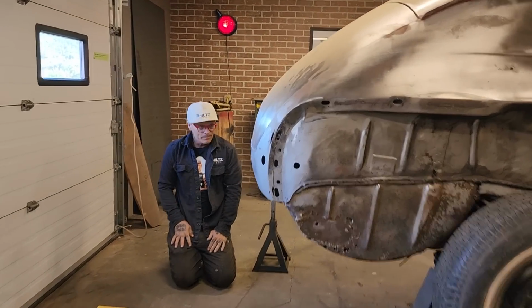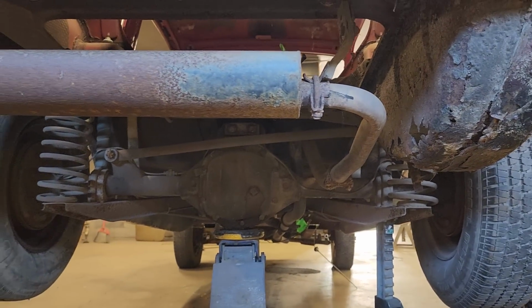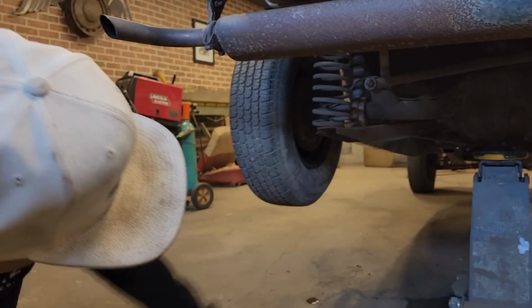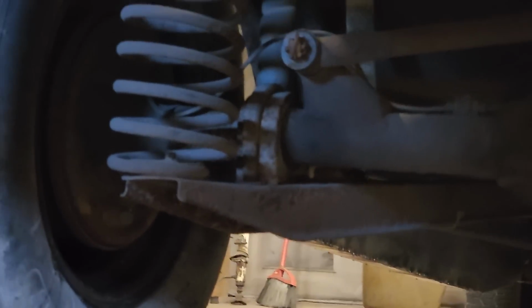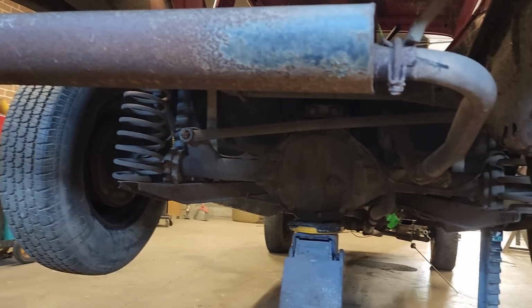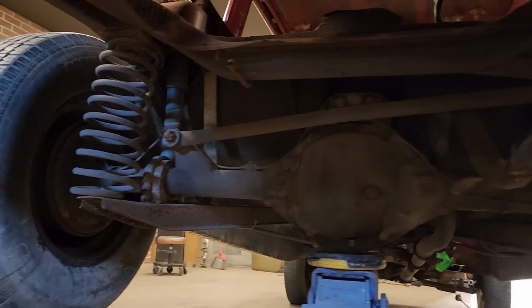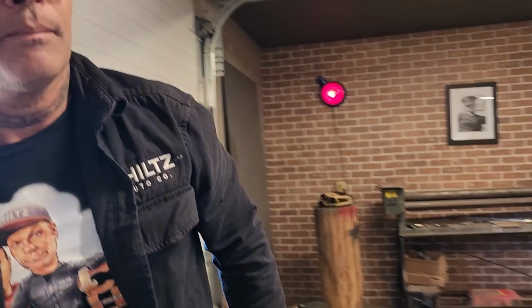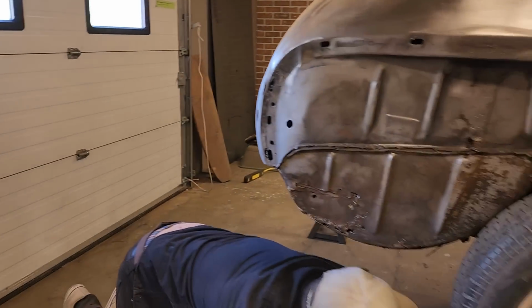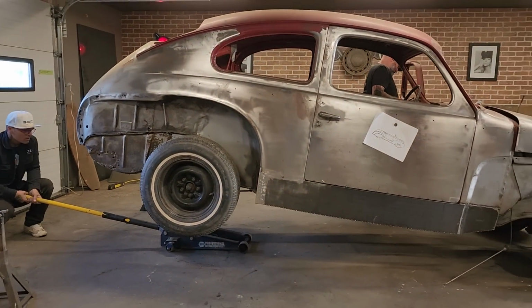If you want to come take a look at this for a second, this suspension that we got going on here is used a lot in bagging cars. The reason being is you can see these trailing arms here, and trailing arms on the rear end go up to the middle. That's basically how every C10 is built, with the exact same crossbar going in there. You could put a bag right on the back easily to lift that up and down. And in the front it has coils, so we'll probably cut the coils in the front, and then we'll lower the back after. Or whenever it comes to it, it'll just be a coil. We'll lower down that way. See what happens.